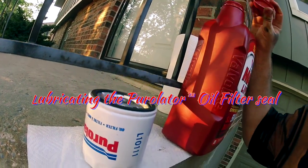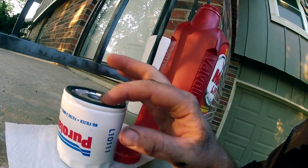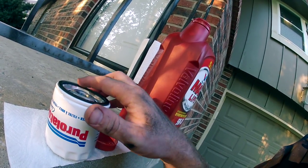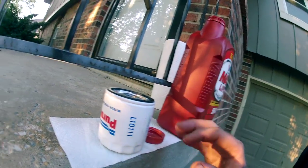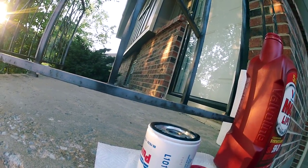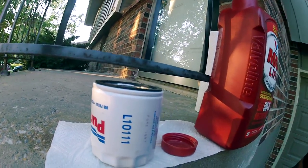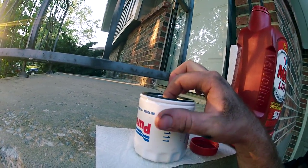Thing to do, absolutely essential, and I always use new oil. I never use old oil. What you do is I just use the oil that's on the bottom of the inside of the cap there, and you just lightly lube up that rubber seal right there. Basically what you want is for it to be able to screw down and not have any kind of bind up. You don't want it to jump track. You want it to stay in there. You want it to spin freely until you can get the filter tightened up